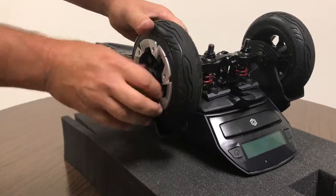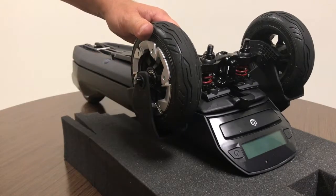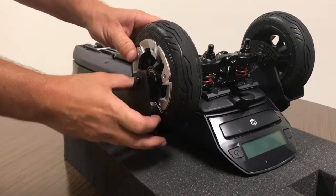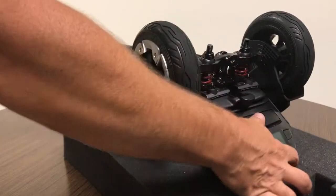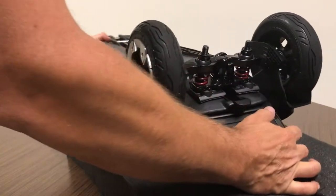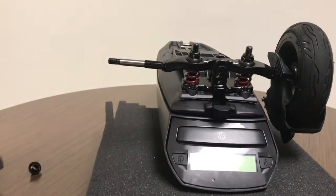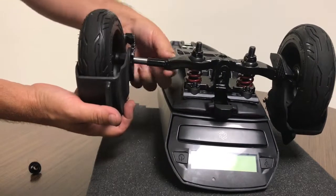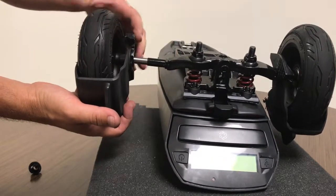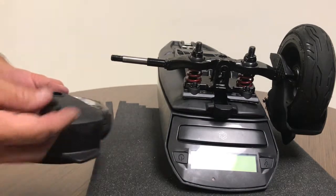Make sure you save all parts. There's a little washer, a little spacer that comes off right after the nut, and then the fender is going to be next. Here you're going to want to get a little leverage to loosen the fender off of its position on the axle, and then the whole assembly comes off.